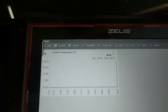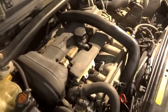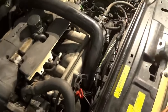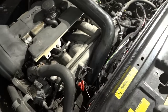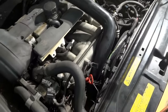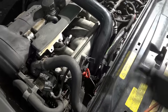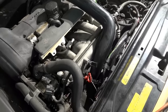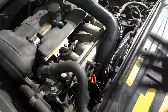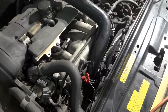This tells me that the cooling fan control module is shorted. As we see on the scanner with the sensor being disconnected, we're supposed to read a very cold signal — and that's exactly what's happening: minus 54.39 degrees Fahrenheit. So the wiring is good and the sensor is good. The issue is the fan control module itself. I'm going to pull up the wiring diagram so we can look at it one more time — it's a very simple circuit. Hopefully by looking at the wiring diagram it will make more sense.